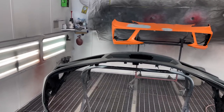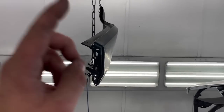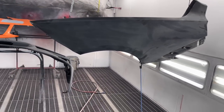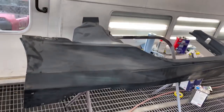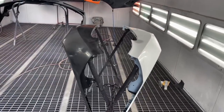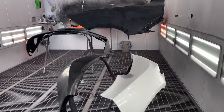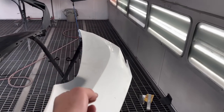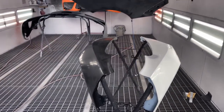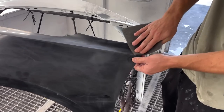We got all the parts set up in the paint booth — the rear bumper, the front bumper, and the quarter panel hung up so it's easier to get into all the cracks. We'll let my brother Paul decide the final arrangement because you have to be careful where you place stuff so you're not running into things in the booth. Here's the rocker. We didn't have enough space for the door or the trunk lid so we'll paint those separately. It's a pretty flat white and an even coat should match up nicely. We need to sand a little scratch and degrease everything.